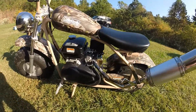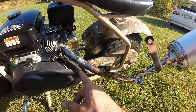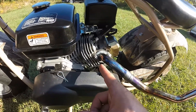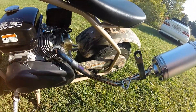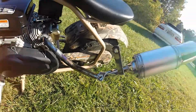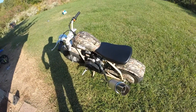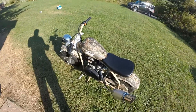Instead, I fitted and kind of modified it to work on this bike because otherwise it wouldn't work at all. So here you go — there's a cut right here, we turned it 90 degrees and then did a 40-degree turn on the flange. If you buy the exhaust system itself, you just line it up and mark it with a marker — something I should have showed on video but didn't. Other than that, it sounds freaking awesome.